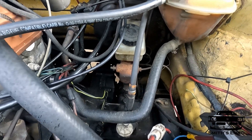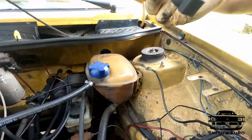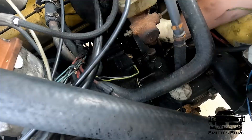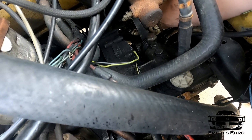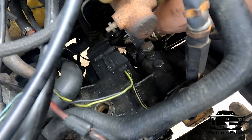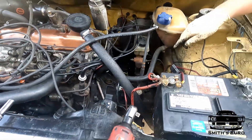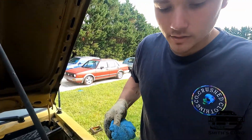Pop it off there, pop it off here. It looks fairly new, but there's no grease in it — you're always supposed to grease inside these two. This is a 10mm and a 10mm, and this kind of compresses it. You never want to tighten it completely tight, but you don't want that much slop. We'll get that out now with the two 10s, and then we'll go underneath the car for the terrible, nasty part of it.